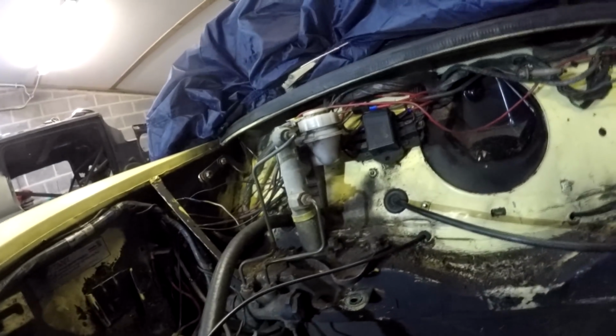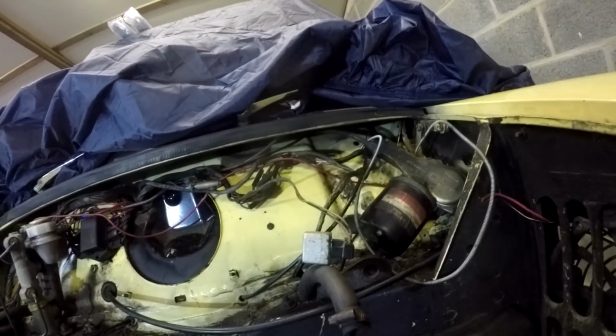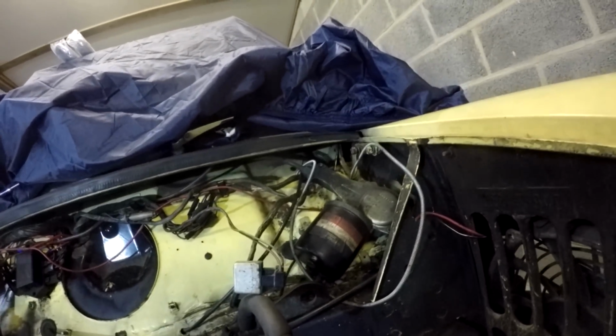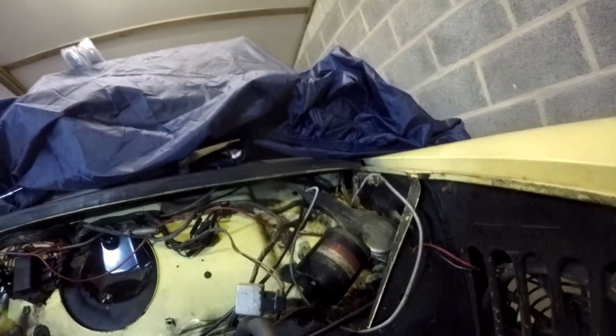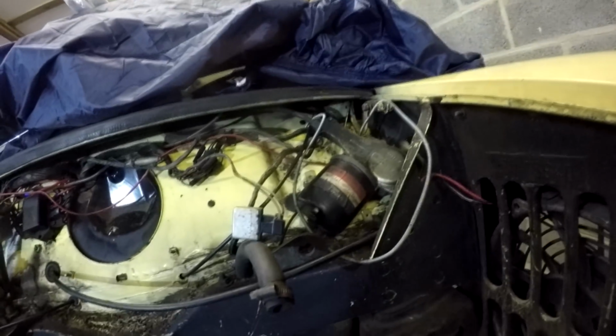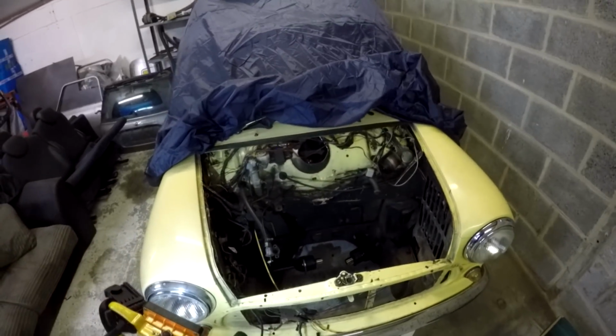Yeah, so we'll continue pulling out the wire, and I think that's the main bulk of what's left. Obviously the wiper mechanism, I don't know if the mechanism itself's really going to have to come out, but I'm definitely going to want to remove the motor at least, because that's very much in the way. I can probably just mask up the mechanism to save messing about taking the wheel boxes off. Right, yeah, so let's carry on, shall we? Actually, I think we're going to have to move inside now and pull that plate off next, I reckon. So let's crack on with that.